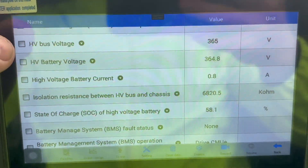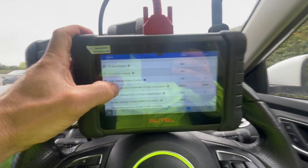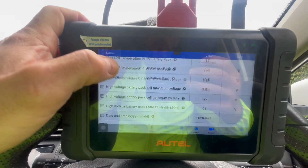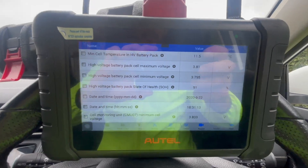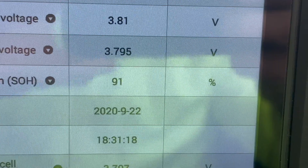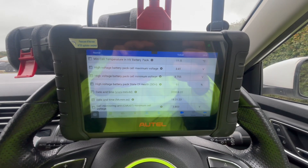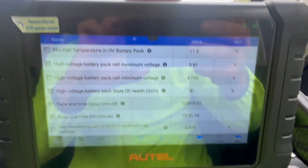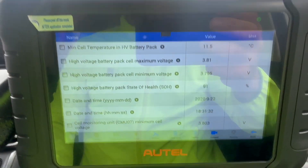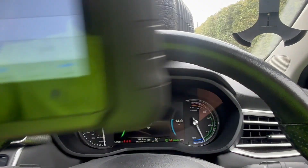And when the display is saying 10%, it usually has about 15%, so when you get to zero you've got a bit tucked away. Now let's scroll down to state of health. State of health was 91 last time I checked it - and there we go, high voltage battery pack state of health: 91%. I'm a bit surprised - I thought that would have probably dropped off by now. That's still pretty good for a vehicle that's done 143,000 plus miles. I'd expect it to drop at least a percent in the next 5 to 10,000.